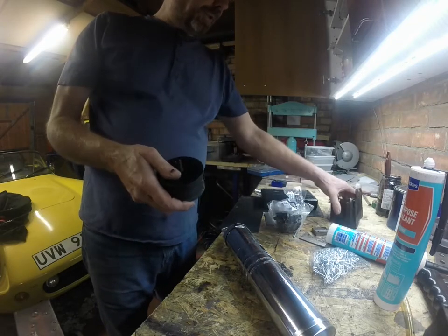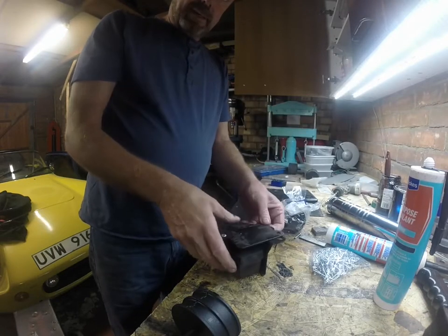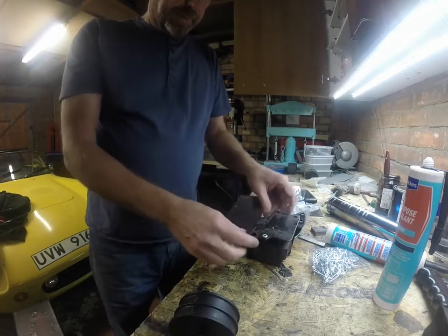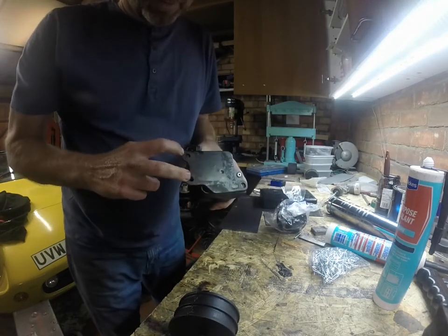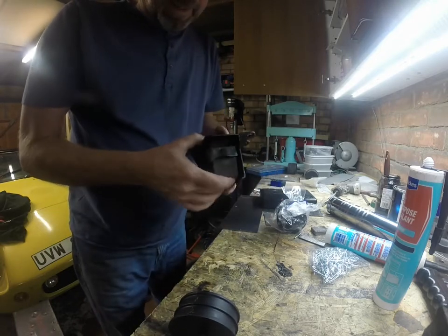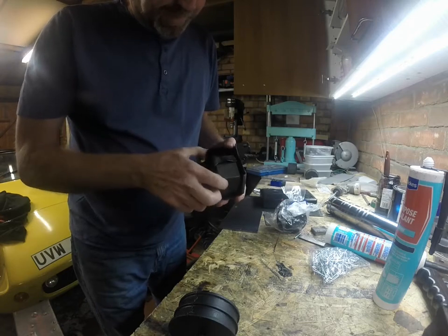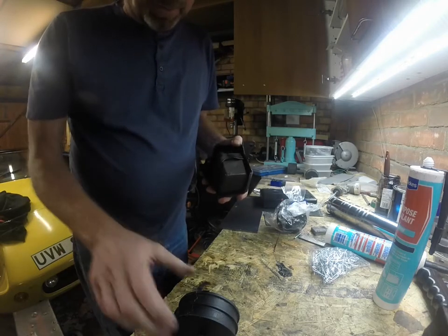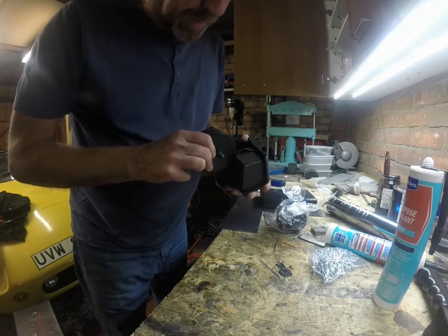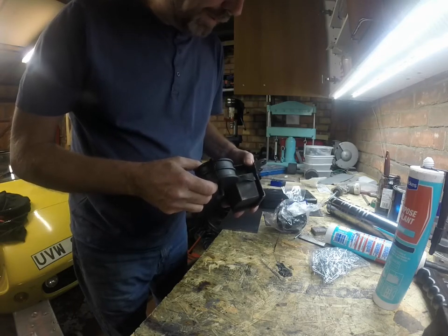This contrasts somewhat with the original RX-8 gearbox mounting, which I have here. This is the plate which bolts on underneath in three places. The reason I don't want to use it is because this gearbox mounting is rather deep from here to here — it would hang down underneath the car. So this Land Rover one, if I can rig it up in a suitable way, should be quite a bit shallower than that. That's my hope anyway.